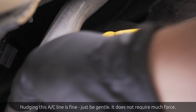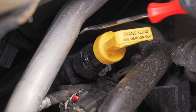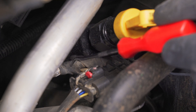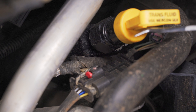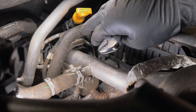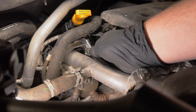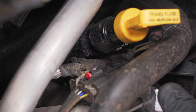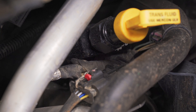To adjust this, just reach over and nudge the air conditioning pipe — don't give it too much force, but you should be able to move it relatively easily and widen that gap to about 3/4 inch or more. The second thing to check is the wiring loom, which may be touching the bottom of the transmission dipstick tube bracket. With engine vibration over time, there's a danger it could rub through and cause a short. To fix this, grab a crescent wrench, put it over the end of the bracket, and very gently lift up, which bends that bracket down and opens about a quarter inch gap. As long as you've got that clearance, there's no danger of rubbing through and ruining the loom.